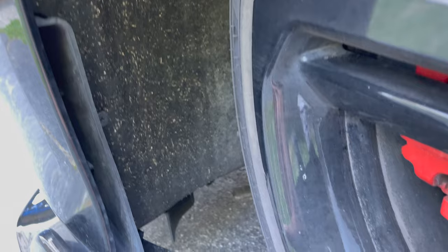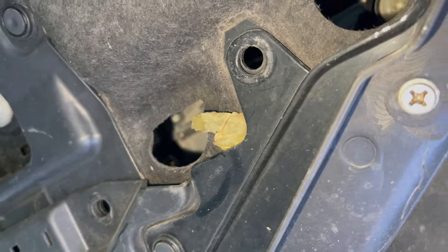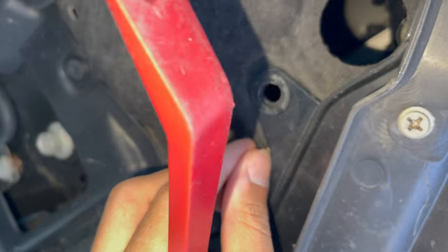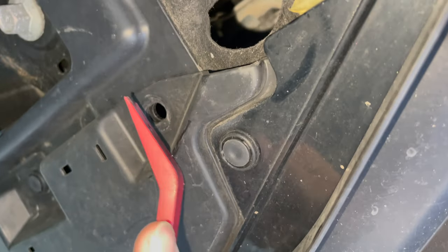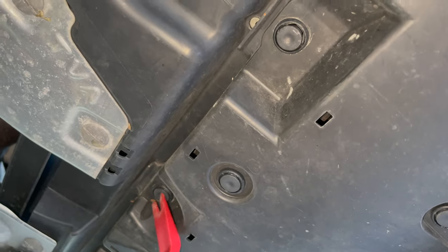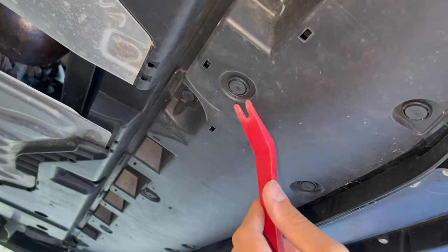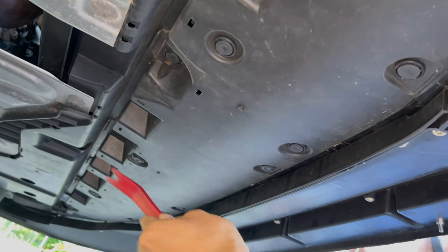It's right there — the Phillips head. That's one, two, and the third one is right here underneath this edge. The clip is right there, and same thing on the other side — rotate your tires. On the bottom of the car, take off the inner clips right there inside the base. You see that? The outer one and the inner one — take the ones that are inward, just three of them, same thing on the other side.